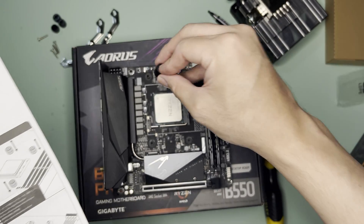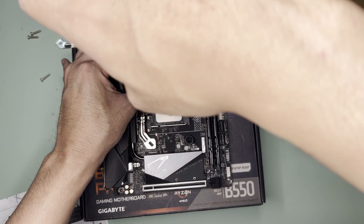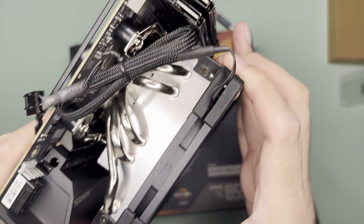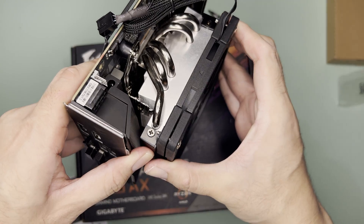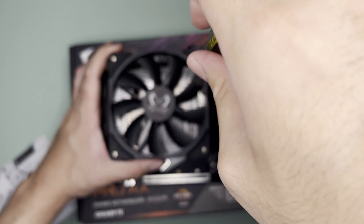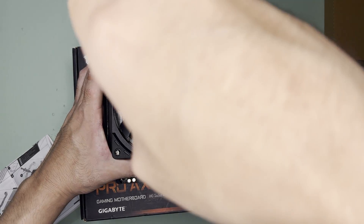As for the standoffs, the rubber should be facing upwards. Place it on top of the motherboard and screw the mounting plates to the backplate. I tried to see how it fits and I think this will be compatible with motherboards with tall VRM heatsinks. However, if you have a tall M.2 heatsink, this might not be compatible. Apply thermal paste and mount the cooler. If you are keen enough, you'd notice that I missed one step, which I will detail at the end of this video.